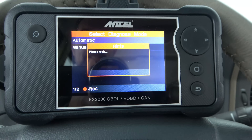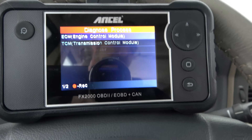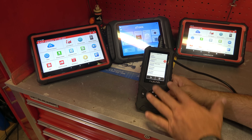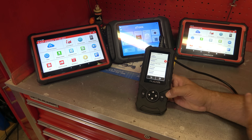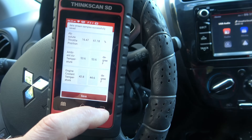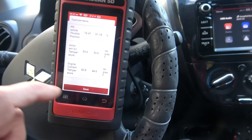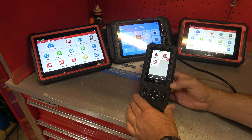It's mid-level. So if you're a tech who's about three years in, and they're starting to give you jobs other than brakes, tires, and oil changes — wanting you to do a little bit of light diagnostics — is it worth getting a tool like this instead of just a regular code reader? Yeah, definitely, because you can dig a little deeper, and anything you don't have to turn over to another tech is a good thing. There are probably a dozen or more tools along these lines. Launch makes them, Autel makes them, Xtool makes them. They'll get you into most systems, allow you to read and reset, and get some live data or freeze frame.